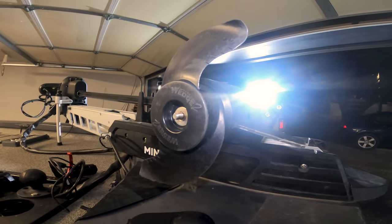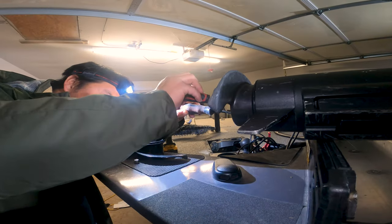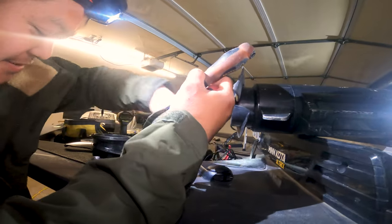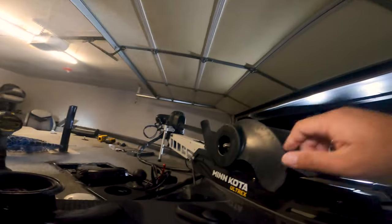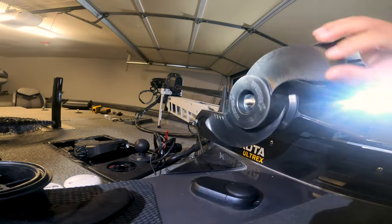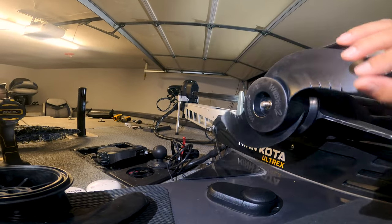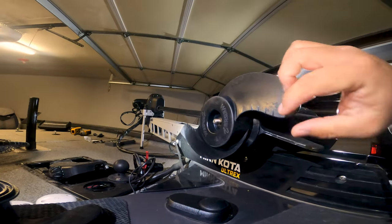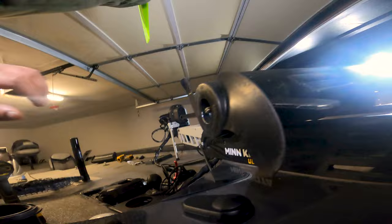So I know we did this last time, but we got stuck right here because we need to hit it with a hammer. Separate. See? Oh, there it is. Okay. And then on top of that, this thing won't come off. Okay, so I need to see if this is even straight. I mean, it looks straight, right? Yeah, it's just straight on there, pretty tight. No, I'm talking about the shaft. I think the shaft is straight. I hope the shaft is straight, because if the shaft's not straight, we got a problem.